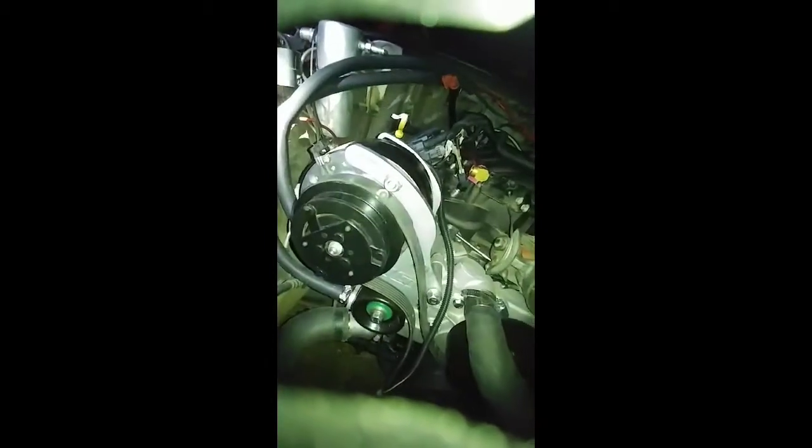It does look good. And like I said, we went with shorty headers because if you have to replace a starter or anything like that, it's much easier to get to and much easier to work on. With long tubes, not downplaying long tube or mid-length headers, it's going to be a pain in the ass to replace that stuff. So this gives a little bit more access to repair stuff when the customer needs to, and I think it was a good choice.